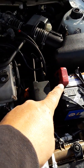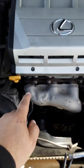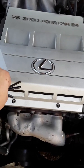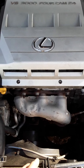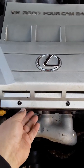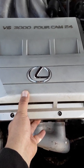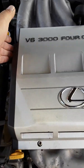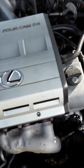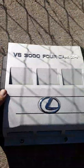First thing you're going to do is disconnect your battery positive. Use your L-wrench on the two bolts — left is loose, right is tight. Loosen both screws, then try to pop the cover up. It'll feel a little stuck — get your hand from behind and gently move it around and it'll pop up like a tight wedge. Place it somewhere you won't step on it.